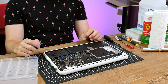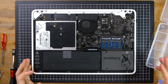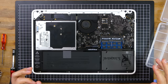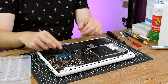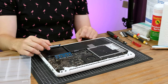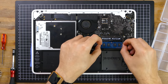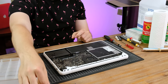Now that we've got the back of the system off, first of all we're going to disconnect the battery. While it would be good to replace the battery, that's going to cost probably another $40 to $50. And considering the whole machine was only $29 to begin with, I think we can live with mediocre battery life. I'm also quite surprised that the RAM actually works — I'm not exactly sure what the listing meant by faulty RAM, but the two sticks of DDR3 seem to work fine. Considering they total 4GB, I don't really see the need to upgrade further, although you can actually put up to 8GB in this machine.